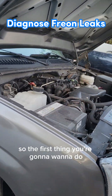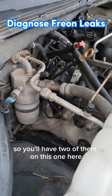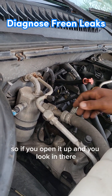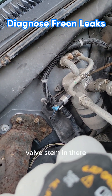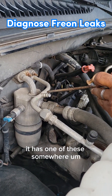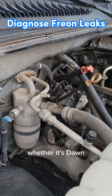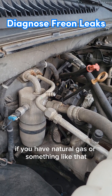Come in here and I'll show you. The first thing you want to do is look for these plastic little caps — you'll have two of them. Each vehicle has a high side and a low side. The low side is where you put in your Freon. Open it up and inside there's a little valve stem, just like the ones on your tires. What you want to do after putting Freon in is get some soapy water — Dawn, Windex, anything that makes bubbles — and spray it on there. Same way you check gas lines.